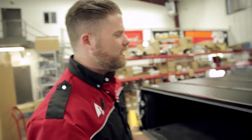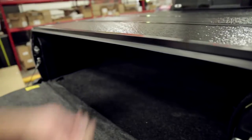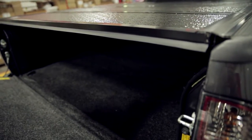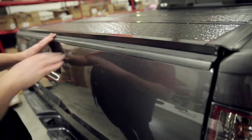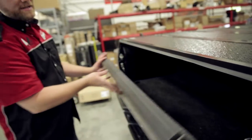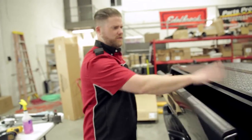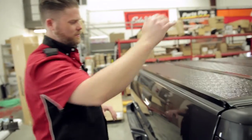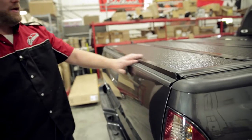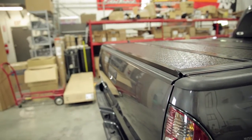One thing you're going to want to keep in mind when you have any tonneau with a gasket like this full length gasket on the back: if you've got the tonneau down and the tailgate down, all you need to do is shut the tailgate first and let the tonneau lay on top of it. Because with that gasket there you could bind it up if you try to shut the tailgate with the tonneau all the way closed. So it's as easy as lifting the tonneau and then letting it lock in place. Then you have this full seal along the tailgate, giving you a lot of weatherproofing.